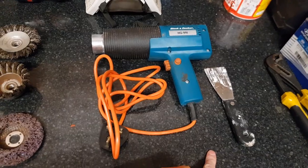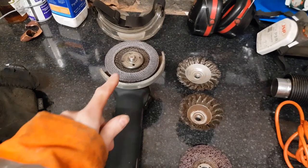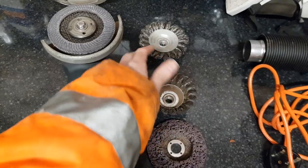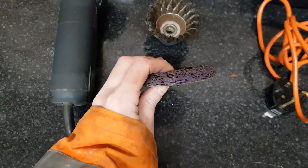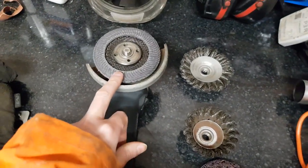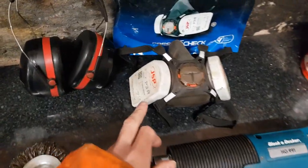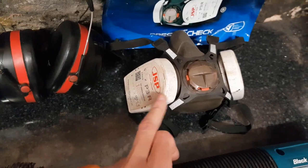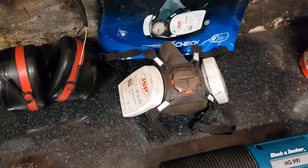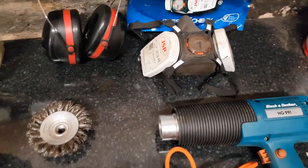To do that I've got a variety of tools. First I'm going to use the heat gun and a scraper to get the underseal off as far as I can, and then I'll use the various discs on the angle grinder. I've got a couple of wire brushes, a stripping clean disc — that one's quite worn, it's like a fiberglass material — and then the flap disc as well. I've also got safety goggles, ear defenders, and this really good mask that's comfy to wear and stops all the dust from going everywhere and stops you breathing it in.